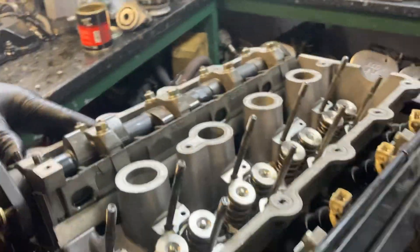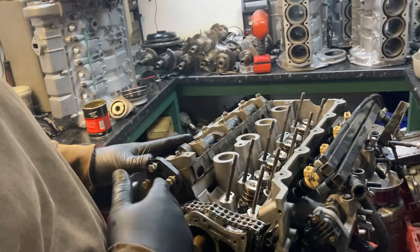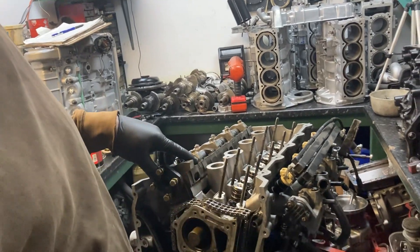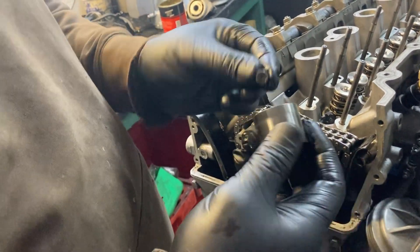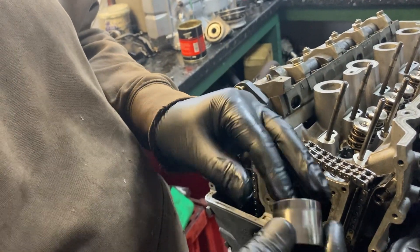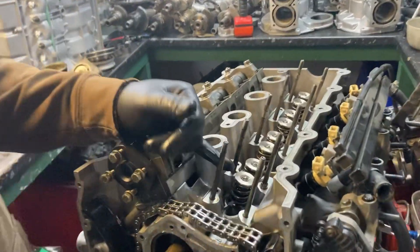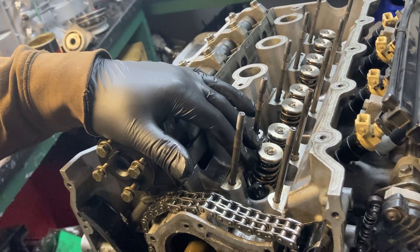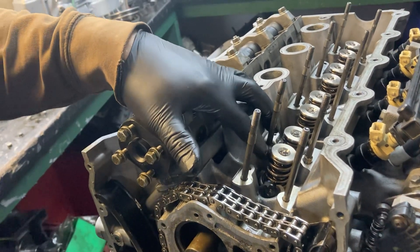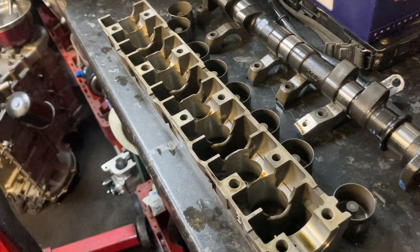These cams are done by Bob Jones - actually one of his 235 horsepower cams he calls a 'Bob's Fat' - don't ask me why he called it that - they're out of his pickup engines which he did for the pickup championship. To talk about the followers: this is the replacement follower, a Cosworth 'long dick' follower. Inside the follower you've now got Vauxhall XE shims instead of your hydraulic - that shim gets the correct clearance between the cam and the valve - so we get a variety of sizes and get the clearances correct. It runs on the original valves which have a nice 6mm stem.